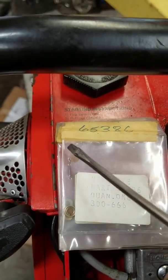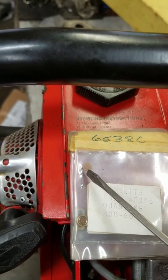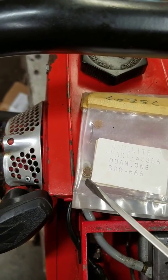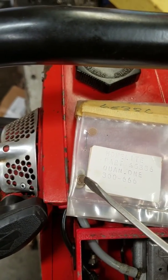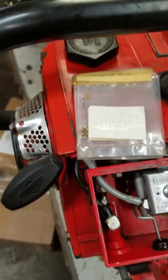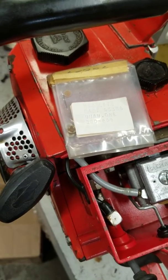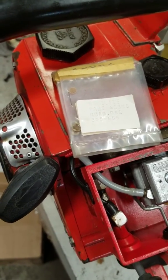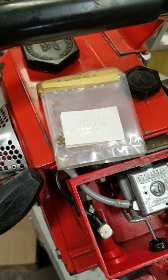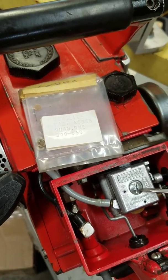At the outlet for the high speed circuit, you've got that little piece of gasket material and then this brass fitting and screen that goes over it. The way it's designed, it's supposed to prevent the carburetor's fuel charge from getting disrupted by any sort of oddball pulse that comes back through the carb.